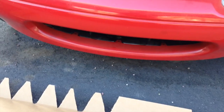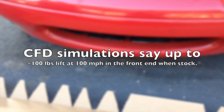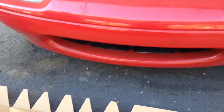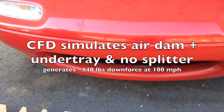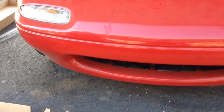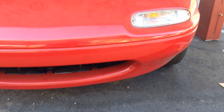It won't act like a full flat under tray, but by providing a front air dam, instead of having fast-moving air going above and below the wing — this wing shape on the nose of the Miata creates significant lift, which is a known problem in racing Miatas. One of the things we're going to do is use this flat air dam to see if we can reduce some of the lift and drag, because these little Miatas have a very high drag coefficient on the order of 0.36, which is roughly the same as a '69 Dodge Charger before they did the modifications to make them into the Superbirds.